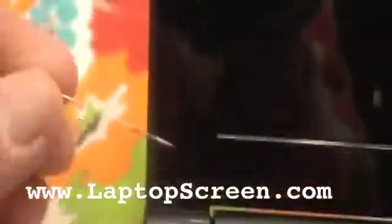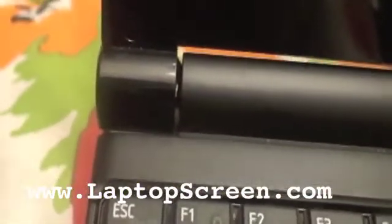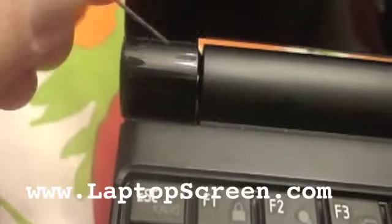The first thing that you do is there are little plastic tabs right here and there's one right here. Sometimes they're on all four corners and you start by peeling those off. I use some kind of small pin just to peel it off because it's kind of like a plastic sticker. And then behind it are screws.